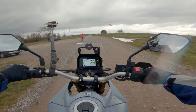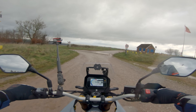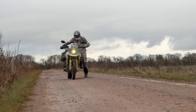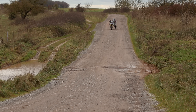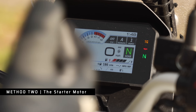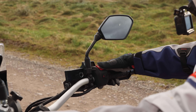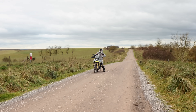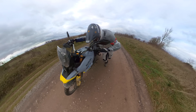This is tricky to get the timing right. It is horrible on the gearbox. Fortunately, Suzuki are well known for having beautiful gearboxes. The much more pleasant alternative is to run with the bike. With the engine running, push the bike up to speed and jump on. With a little bit of speed, we can then drop the bike into gear much more gently and we're away. The limit here is that it's hard to push the bike up to speed, and if the terrain is not smooth and flat, it is nearly impossible. The other option is to use the bike starter motor — pop the bike into first gear with the engine off and then start the bike, keeping your thumb on the starter and turning the throttle at the same time. It helps to have flat or downhill ground for both of these methods. Both are harsh on your bike, but they're both going to get you out of trouble. I prefer the starter motor method to just dropping it into gear — it is a bit less crunch on the gearbox, and starter motors are easier to fix than gearboxes too.